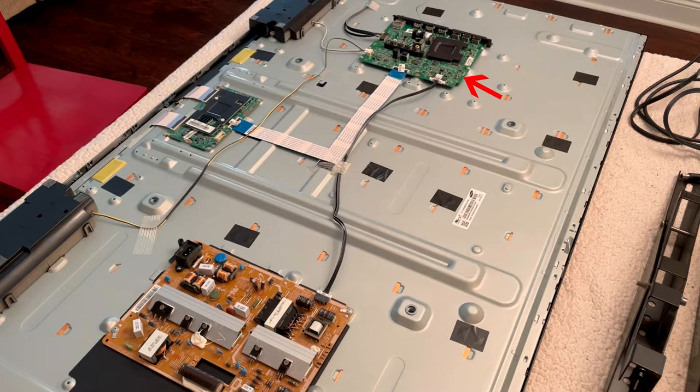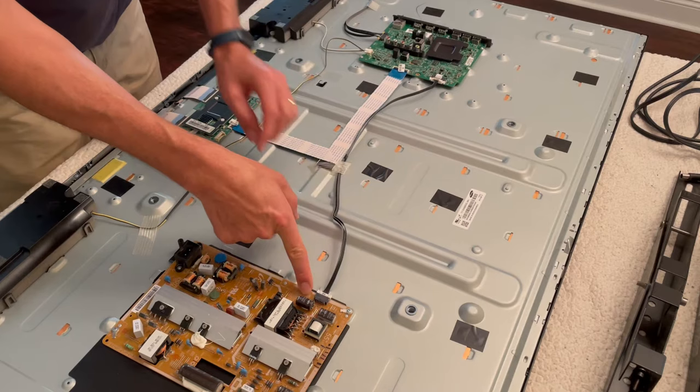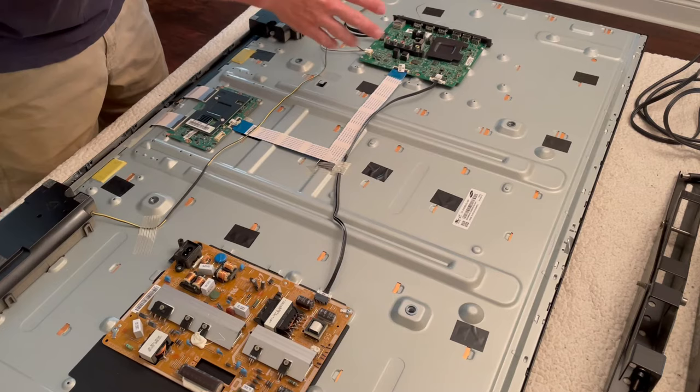All the pins registered around 13 volts, and with the smart board unplugged, the TV actually stopped rebooting and the backlight remained lit, which told me the backlight was functioning properly and the power board was putting out the correct voltage. After this test, I felt certain the smart board or T-Con board was defective. I unplugged the T-Con board and powered on the TV to see if any symptoms would change, and the TV wouldn't even come on. After remembering that the first sign of our TV having a problem was a loss of audio, I took a hunch and ordered the smart board because the speakers plug directly into that board.